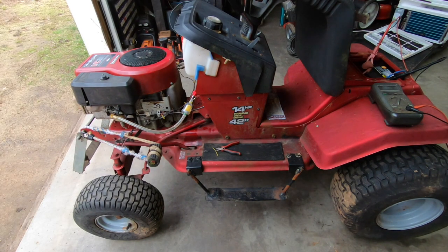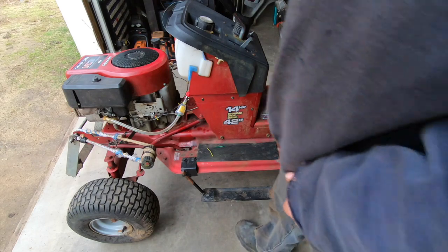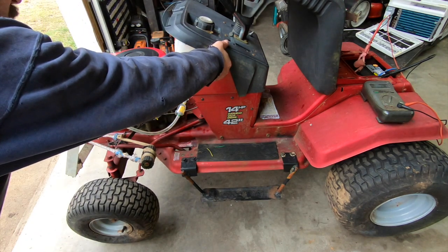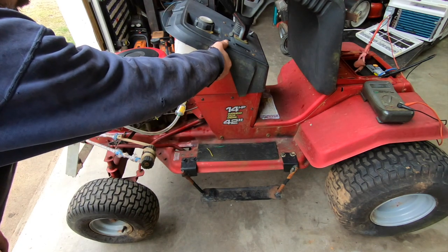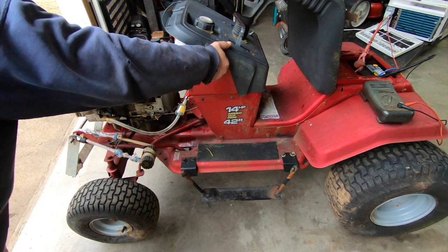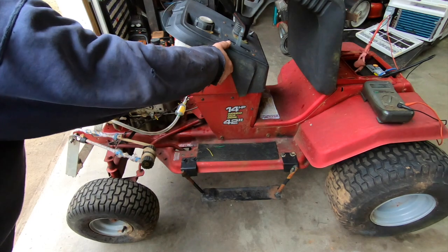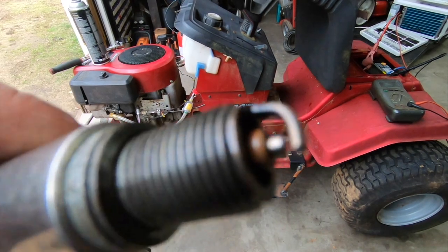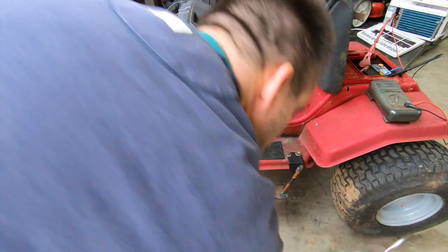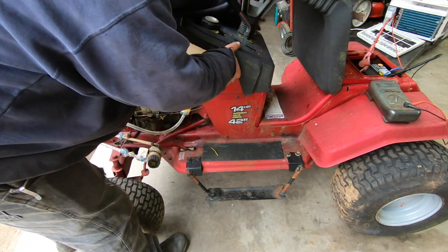Every time you put your tools away. All right. You're gonna see if the charging system's working. We were at 1292 because I just took it off the charger. Choke. Let it rip, potato chip. That'll do it. All right, clean that soaking wet spark plug off. See if we can get this thing to light off now. Put the ignition on. Oh, didn't turn the carburetor thing on.